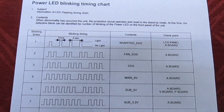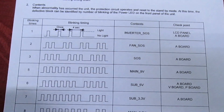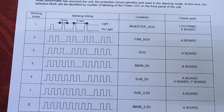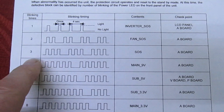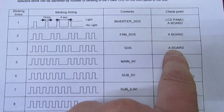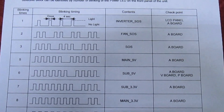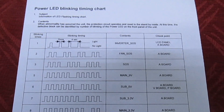I've actually checked this problem and it's not the main board at all — it's the power supply board that's the problem. There's a voltage missing on the power supply which is supplying the A board. That's why you can't rely on these codes; it's a total red herring. It's not the A board that's faulty, it's the P board. So let's move on and take a look at what the problem is.